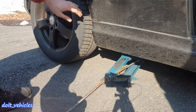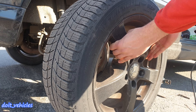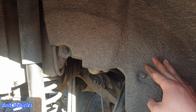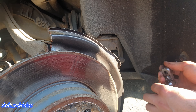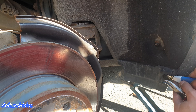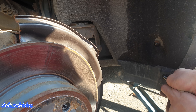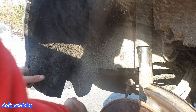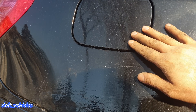To access the components, you'll have to lift the car from at least the rear right wheel and remove the wheel. Now you get access to the wheel splash shield. You've got 3 10mm nuts and one more over here. You have to remove all the plastic clips you find around this wheel arch — try to catch, twist, and pull at the same time. Once you remove the wheel fender, right below the fuel tank cap, under here you'll find the evap canister.